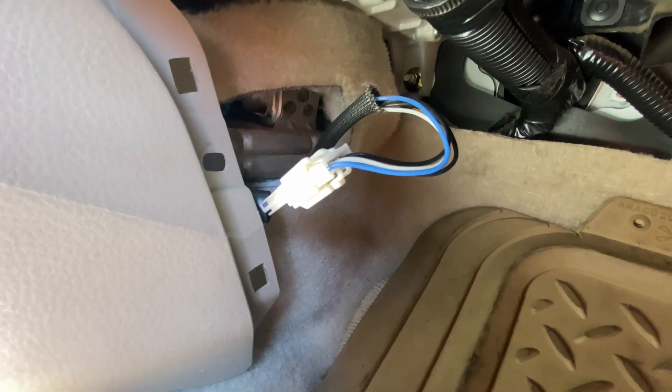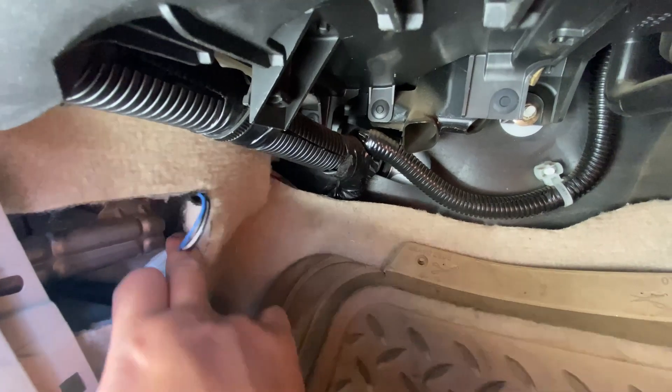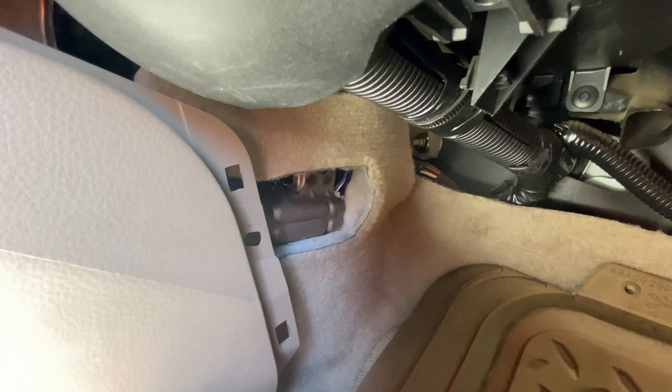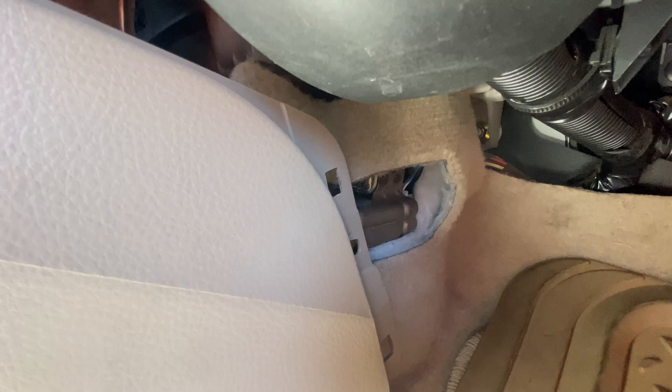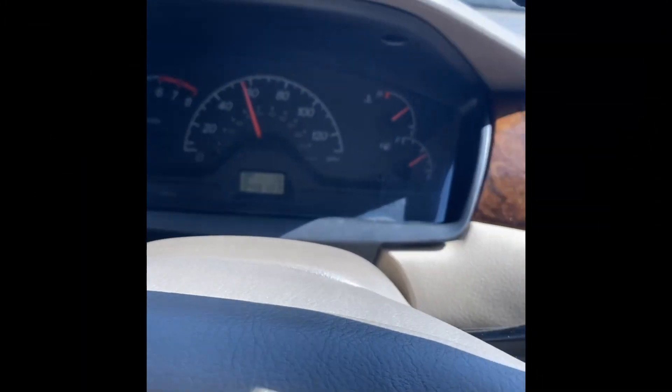So that's how I was able to diagnose and fix it. Other than that, the majority of the time your easy fix for the P0141 code should just be replacing that second O2 sensor. If that doesn't work, just check the wiring — it probably came from the factory wrong. Alright you guys, thank you for watching. Don't forget to like, comment, subscribe and share this video if it helped you out. Look — no check engine light!